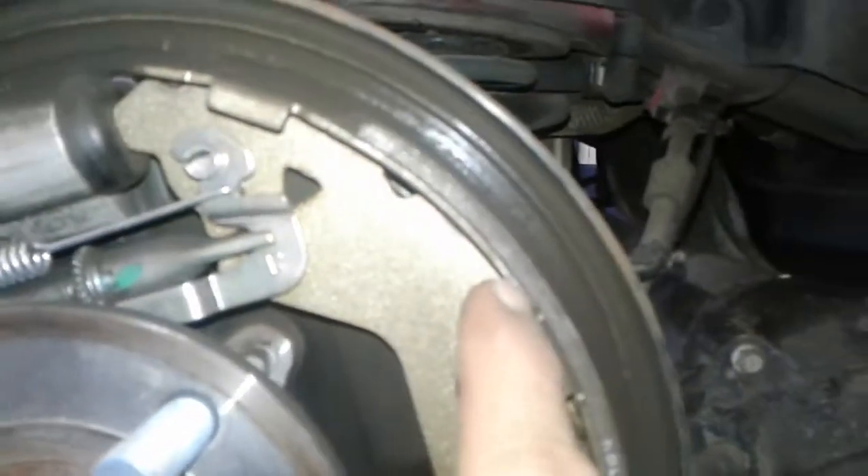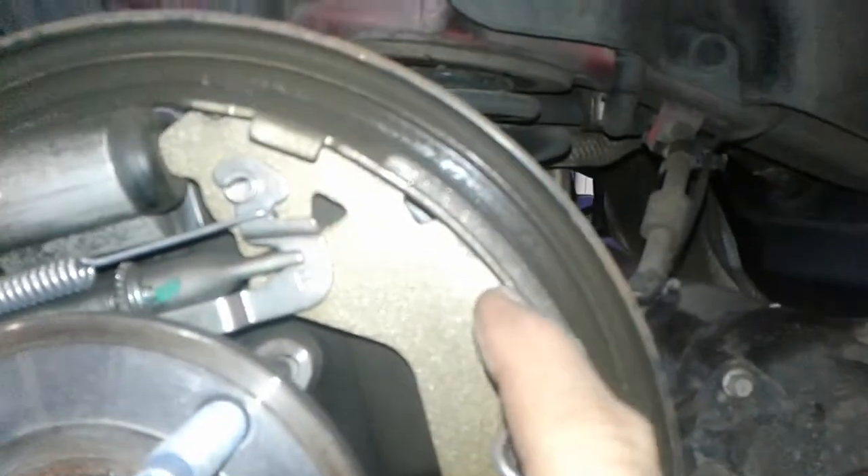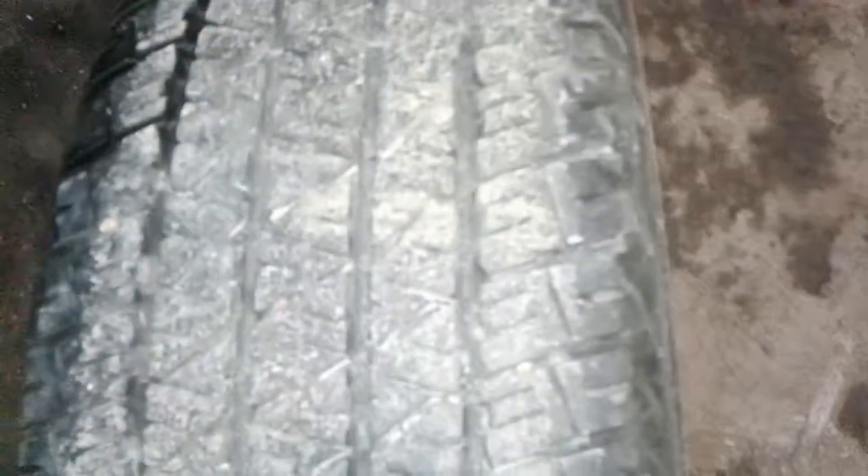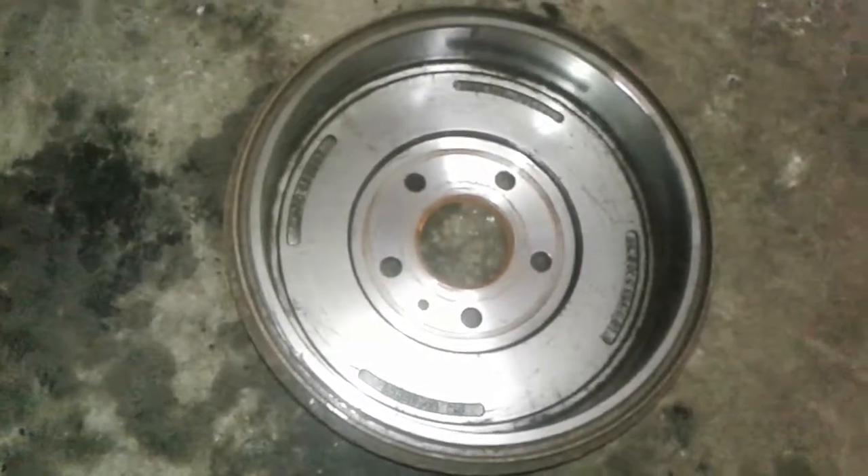On the rear right, there is no leakage as far as the shock goes — it is good and clean. Your spring is intact. I've pulled the drum off so you can see how much brake you have. These brakes are about 80% left — about 30,000 km remaining in the rear. I've checked your wheel cylinders and these are recently replaced, practically very new. In fact, this whole brake system has been replaced very recently. Your rear tire has the same tread as everything else — about 90% — and your drums are very recent, essentially new.